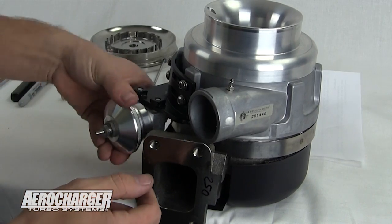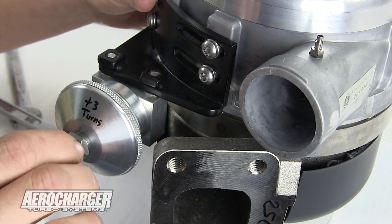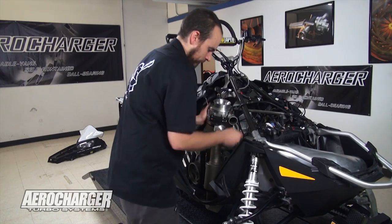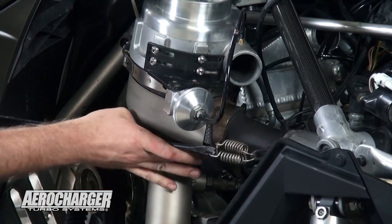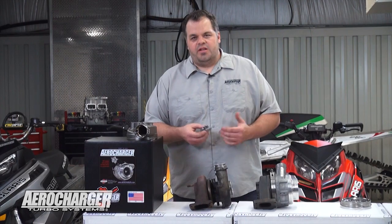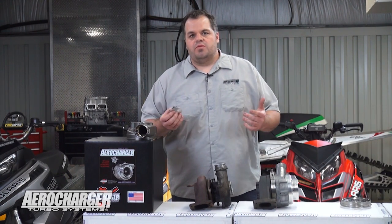D5 is a premium material for very high temperature exhaust manifolds, turbine housings, and things of that nature. We've used it from day one and we continue to use it. What's nice is since we are the manufacturer of the turbo, we've modified this turbine housing to accept the Polaris gasket. So this actually goes directly onto the pipe without having to have additional flanges and things of that nature.